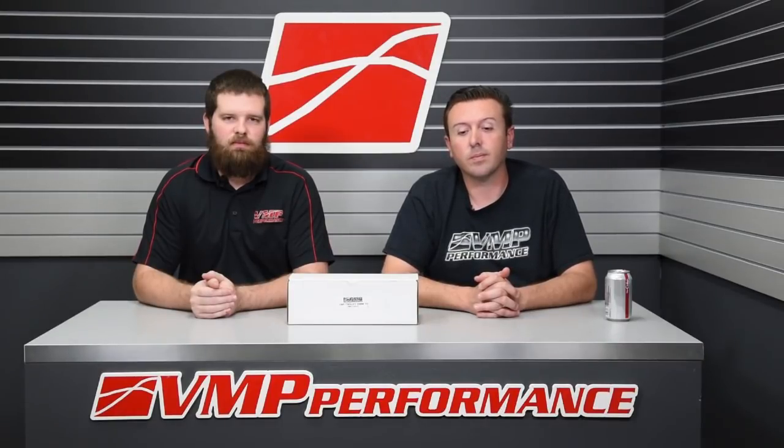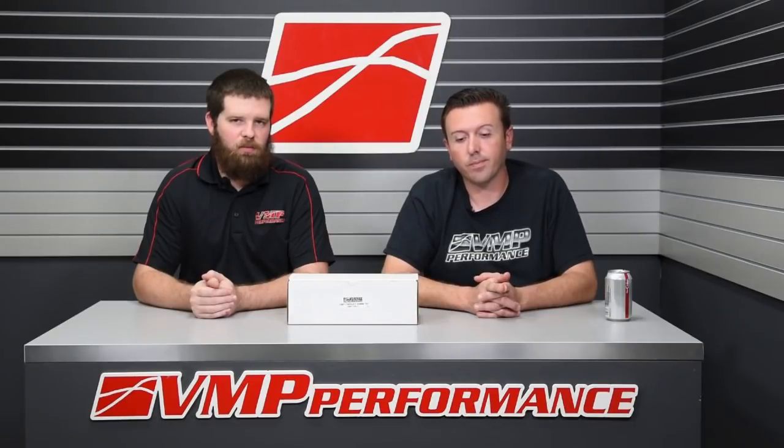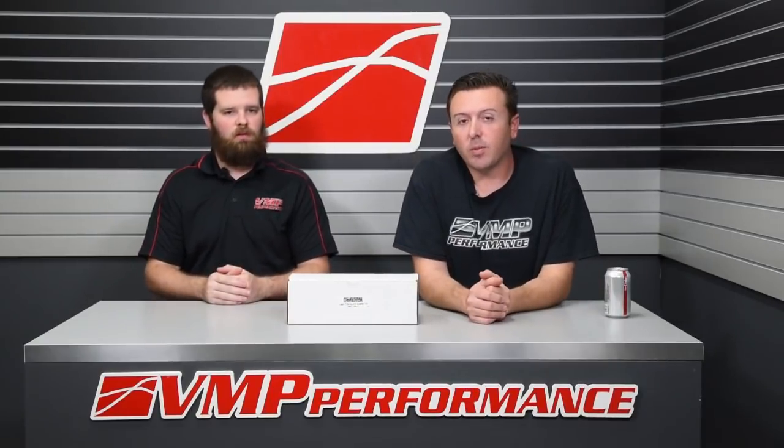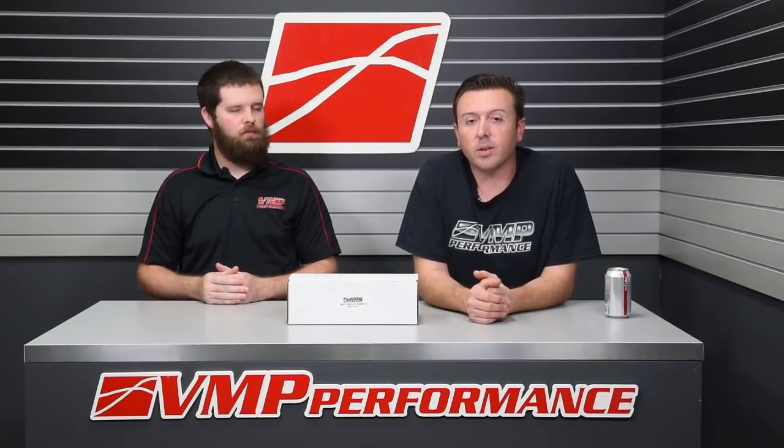Gerald says, are there drive-by-cable throttle bodies available for Coyote engines? The closest you're going to get is our Cobra GT500 pattern throttle body. Most of the manifolds that use a dual blade throttle body, that Cobra throttle body would bolt directly up to and uses a cable-driven throttle. We've got some people running standalones with VMP blowers and they're using that.